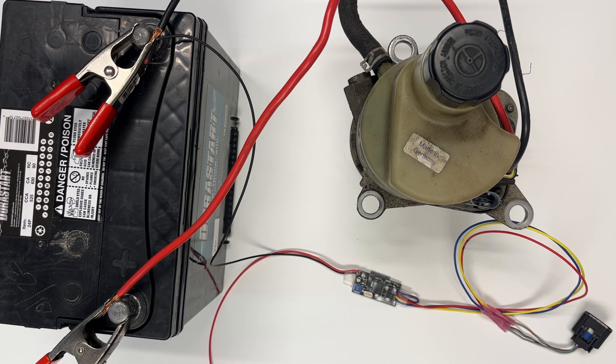Let's talk about some common problems and troubleshooting. If the pump does not start as soon as you get the wiring hooked up, you'll want to make sure your ignition and CAN bus wiring is correct for the pump that you're using. The second thing you can check is the battery voltage. These pumps do pull a lot of current and you need a good battery, preferably with the car running and the alternator charging, to get good operation out of these pumps.